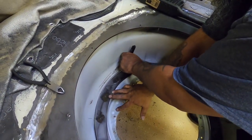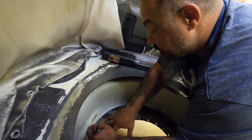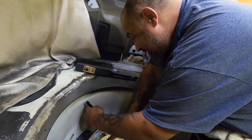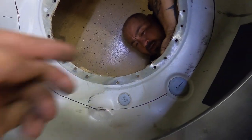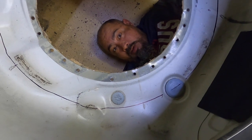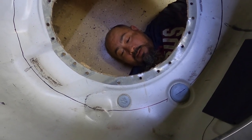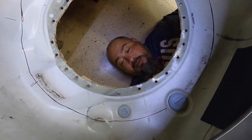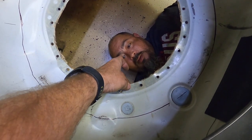I'm letting Sumo trace the perimeter of this ring because he's going to be the one welding it in and he's going to be comfortable with the gap between the ring and the sheet metal. What happens if the gap is too big, Sumo? Extra welding. Lots and lots of fabrication. We're going to salvage the plug — just in case we can make use of it. Sand the seam sealer off — that's how I got it out. I just cut between the seam sealer, cut through that, and got between the two pieces of metal.